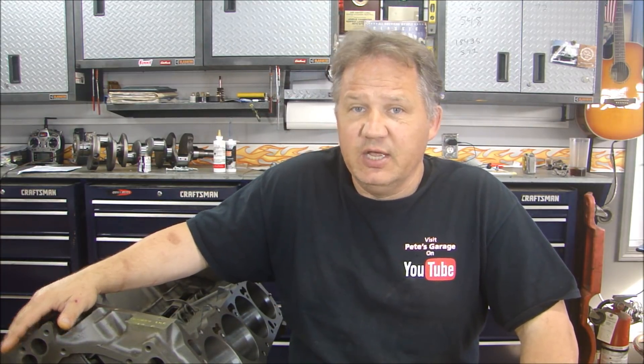What I'll do in this series is, as I put parts in, I'll put the manufacturer and the part number. So if you're building a 440 and you want to follow along and build one for yourself, you can at least know what parts I use. This engine is going to have a steel crank, cast iron heads instead of aluminum, and still going to have an aluminum intake manifold carb. It won't be as expensive since we're not going as high performance.